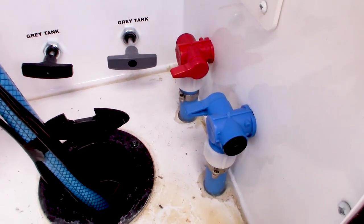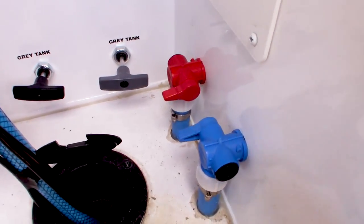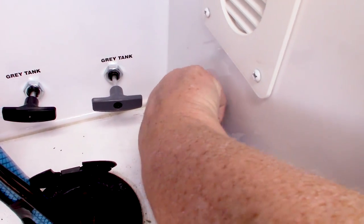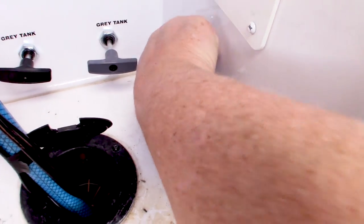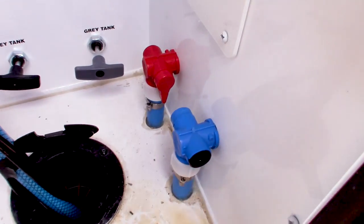The first thing I'm going to do is drain out all the water that's in the freshwater tank. On my Grand Design, all I have to do is switch these right here and it dumps out all of my existing freshwater onto the ground. I've refilled the freshwater tank — I'm going to flush it through the pipes by running it out every single faucet in the house. When that's done, I'm going to go ahead and refill it with the bleach.